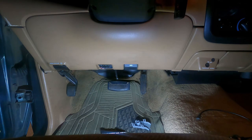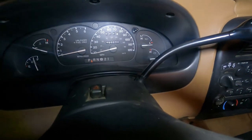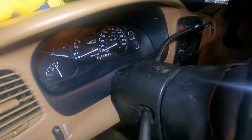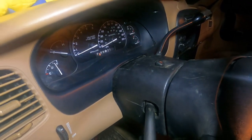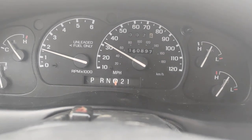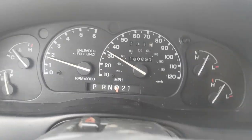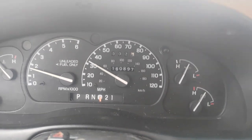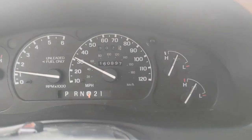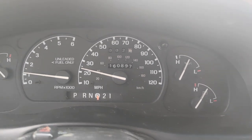All right, it's all back together. The dash is all back in, all the lights are working, and the odometer should be good to go now. We got all this panel back in, so that's about what it takes to get the odometer working again when that worm gear is broken. I was worried I was going to have to dive back in there, but it recorded about three quarters of a mile and then stopped, and after pressing the trip reset button a couple times it looks like it finally caught — all the gears meshed — and it's working as it should now. The odometer is fixed.